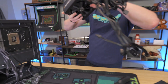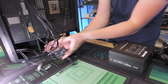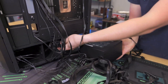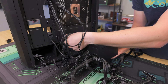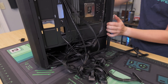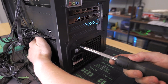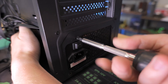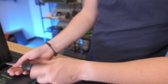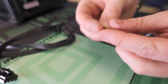New power supply — let's go. You want to make sure your fan faces down 99% of the time. You see a dust filter down here, which means our fan is going to face down so that all the heat from the power supply is totally separate from the build. Your motherboard and all that stuff can still stay plugged in; your graphics card can usually stay plugged in. So you hold it in at the back — and you want to use coarse-thread screws for these. They have a very fat head and little ridges on the bottom to help them lock in place.